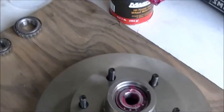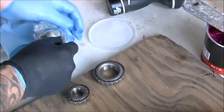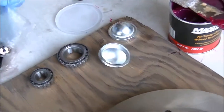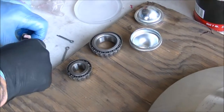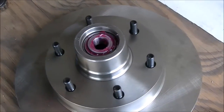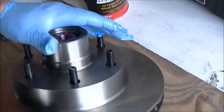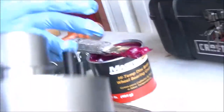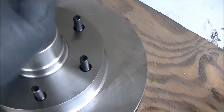The CPP six-lug conversion kit comes with all the bearings, dust caps, and all the hardware you need for it - so this is all right here. We're just going to put them on. For now we're not going to put the dust caps on just yet. That seal on the back side will hold that bearing no problem - it won't fall out. But the front one you've got to pay attention to because the only thing that's going to hold that bearing in would be the washer and then the castle nut.